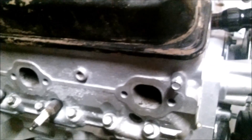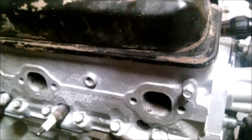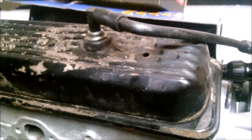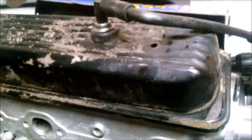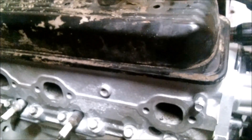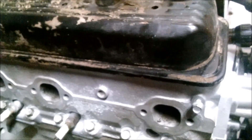Spec-wise, this should be - according to the Comp Cam little program you can download, a really easy simple program - about 230 horsepower, which is a big difference over a 180 to 190 horsepower stock engine. If I was to do this again, I'd get the 2000 and up heads - maybe consider a newer 4.3. Big difference.